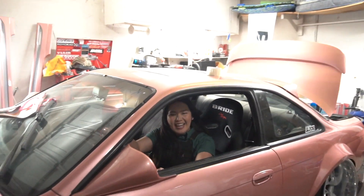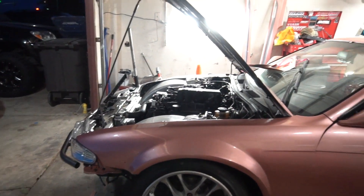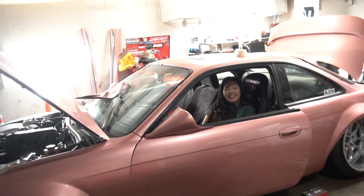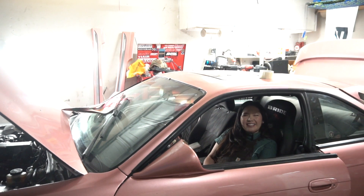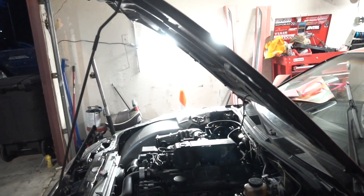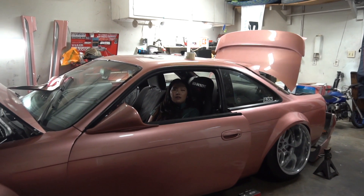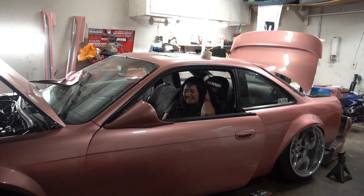Well it needs to warm up too. That works! That means we can bring this car in the garage again. Yes, that was so simple. So there are a couple of vacuum leaks that we need to go over - I already taped off a couple on top of the intake manifold but there's a whistle so we've got to find that.